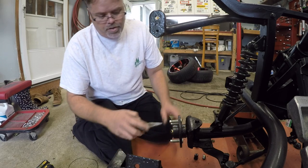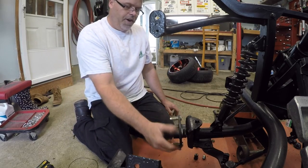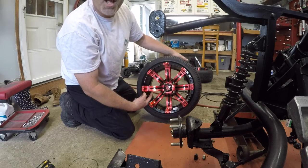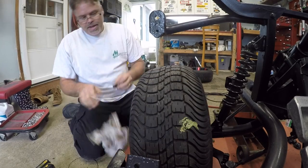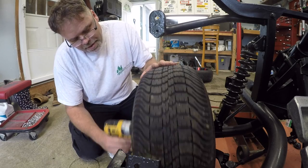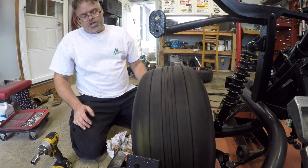Make your own cotter pin - why wouldn't ya? That works good. We'll bend it over this way like so, and bend this one over this way like so. And there you go - that's not gonna go anywhere. So now we can roll in the rim and slap it back on. We'll just snug them up - one, two, three, four, five, six, seven, eight. Still got a little bit of play to them, but it's in the shaft.